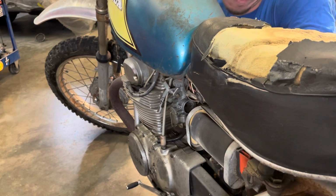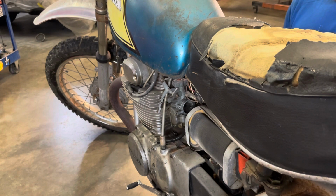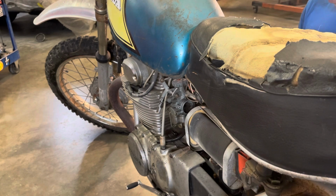I expect to have issues from the fuel system based on the fact that the fuel valve was left on, which when you do that, fuel runs downhill, gets into the carburetors. The slides are free. It's plugged real clean. Not fuely, which means I wonder if it wasn't running on all cylinders. That plug looks new. So with this plug being clean and that one being sooty, that would lead me to believe that we either got a fuel or a spark problem on this side. Unless the guy just cleaned this plug and didn't clean that one.